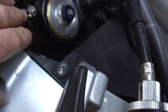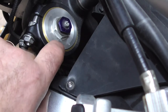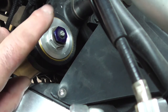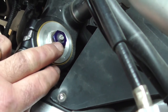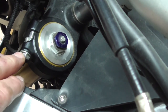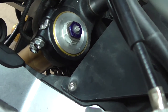Okay guys, so all torqued up. As I say, alternate, go backwards and forwards, make sure that you've got them clamped up. As you see there, I spoke earlier, make sure that your measurement at the top where you was before are exactly as is. 1 mil past, 2 mil past, 5 mil past, 10 mil past. Just make a note of that before you actually start. I've not altered all the dampers on it, so the tension, so that's neither here nor there. So I've clamped, I've tightened those up, bottom one, this one, then those, back in reverse. So all these have been torqued up.